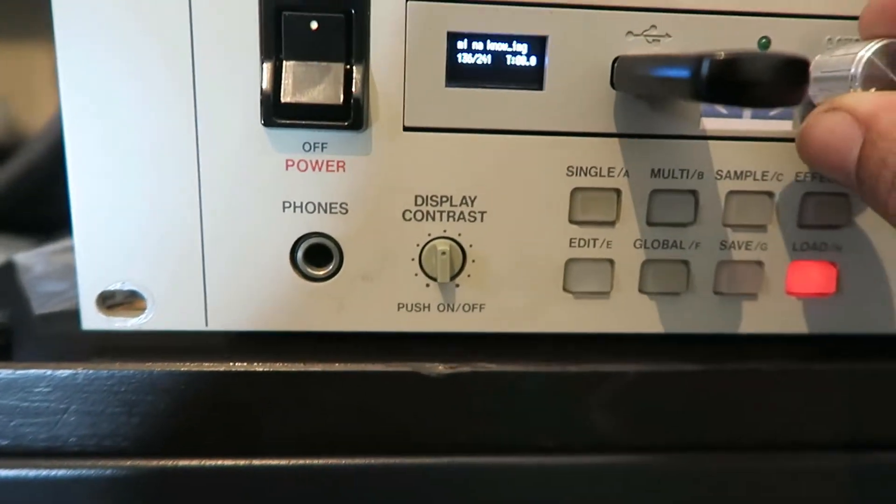I've got my HXC sound library working pretty cool. I've got this HXC emulator in the back here and it's got a screen on it. When you've got the screen and you've got that FlashFloppy installed, it's a whole new ball game — you can put folders on there, organize your whole collection, and basically have unlimited floppies. In my opinion it's much better than having a hot swap SCSI card reader because you have a lot more flexibility. The only minus is that you can't search your entire library, but you can do it pretty quick by computer — find the disc, stick them in a folder, and then just load them in. It's still a really cool way to do your archives.